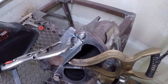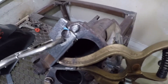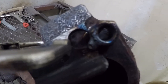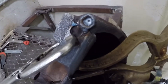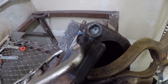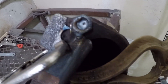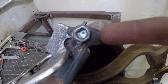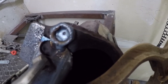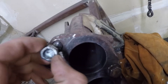Everything's nice and warmed up. Going to do a little welding — it's all welded on there now. When we extract it, we want the manifold to be warm and expanded, and we actually want the bolt to be chilled and shrunk, so we got to wait for this to cool off, warm the manifold up a little, then try to extract it. It's really a delicate process — all you've got is a weld and a lot of hope on a 10-millimeter surface. That did not work — not enough penetration, too far down to reach.